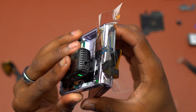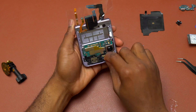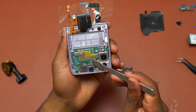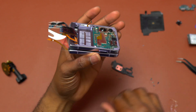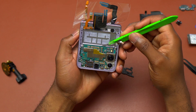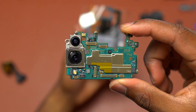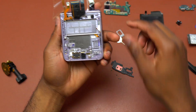Normally the hinge should not have any noise — the noise you're hearing might be the cause of the inner screen not working. For the rest of the removal, I removed all the screws on the plastic covering the camera and front speaker, disconnected the front camera flex cable, then removed the SIM card tray. After that, I simply lifted the motherboard of the Galaxy Z Flip 4 out of the device. Make sure you remove the one screw holding the motherboard to the frame before removing it.